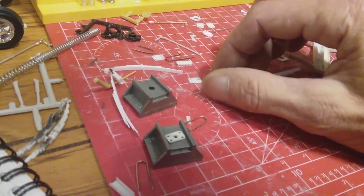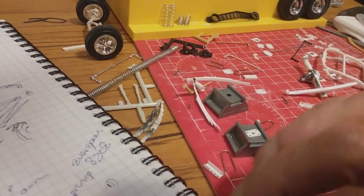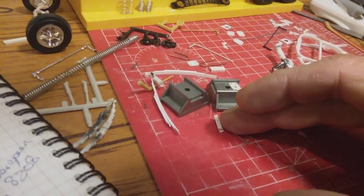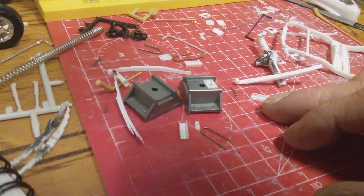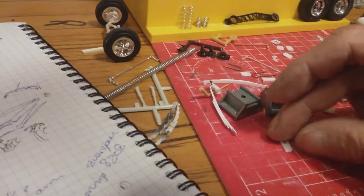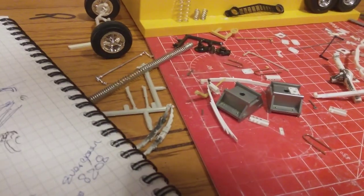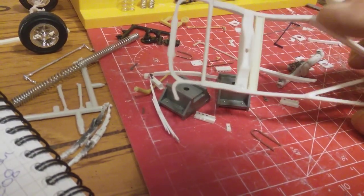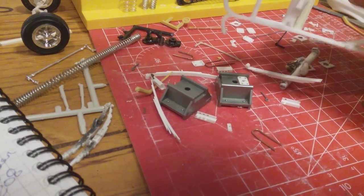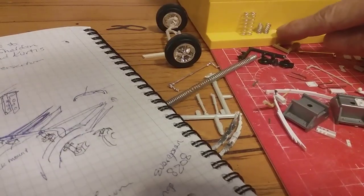This thing wiggling around on the pin is one of the frame mounts, which is a piece of channel that I've drilled through. And then I've got another one, it's hard to see around this camera, which has got 3 different drill points for height adjustment on the rear. So I've got an eye on one end of that that will go through the single pin mount on the chassis, and then an adjustable mount for the tang end to go through. The one in the background's in better focus than that one. Also in the chassis itself, I've cut a piece of beam that I've inserted there. It's only just sitting there really, so I'm going to replace that part with my new beam to mount the top of the shocks to, which I've been making springs over in the background for.